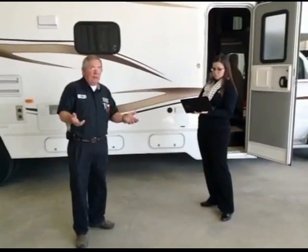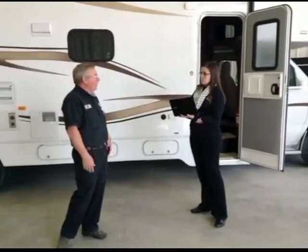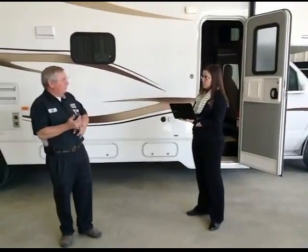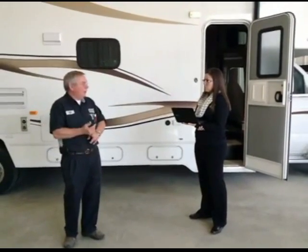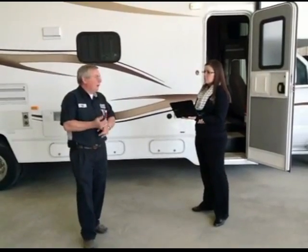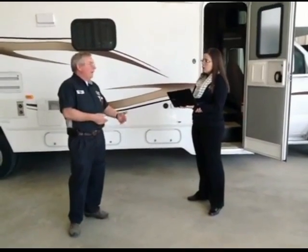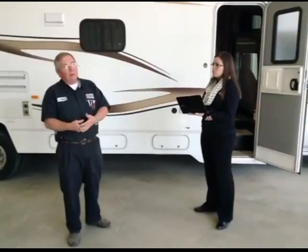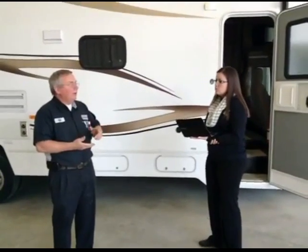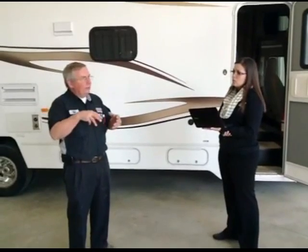Yeah, definitely. Is there anything as far as sewer related that people need to be aware of when they're either winterizing or unwinterizing that area? Well, when you're winterizing, you're going to flush all your antifreeze down your drains, and everything you're flushing out goes into your sewer. The very last thing you're going to do is empty your sewer. And in the spring, when you get done running all that out, before you take off, you could run enough water to have a half a tank of gray water when you get done. So go out and drain it.